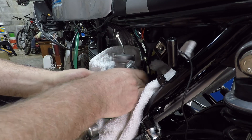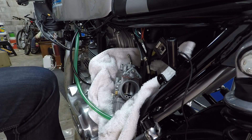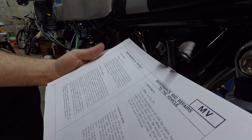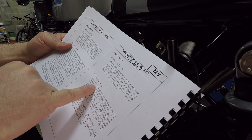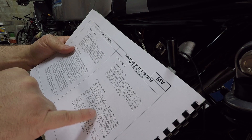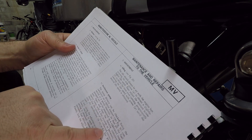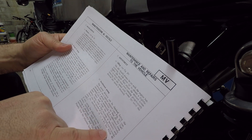I had to figure out the best way to do that - first, what do you adjust it to? If you have the repair manual for the 900SS, page 146, accelerator pump: pump delivery can be checked by fixing the carburetor to a special support connected to petrol, so you can measure how much fuel comes out. Open and close the throttle completely 20 times with a few seconds in between, and check that the volume of fuel collected is 8cc plus or minus half a cc for the PHM 40.